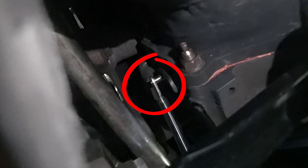I shall show you the problemo. Can you guys see that little rod? I'm going to circle it on the screen. That rod slips onto the wastegate flap and you can see it's just on there — there's a little bit of a bend. We need to put a little clip there so that it's connected up and then we should be good to go.